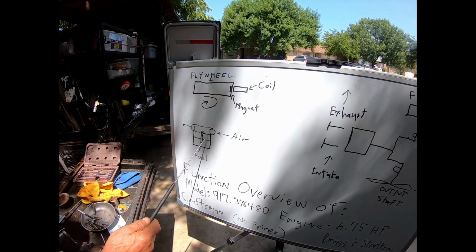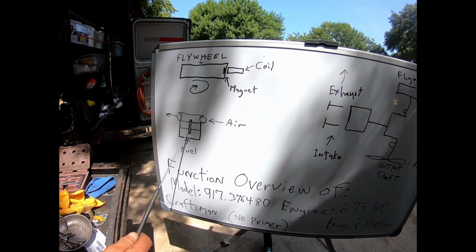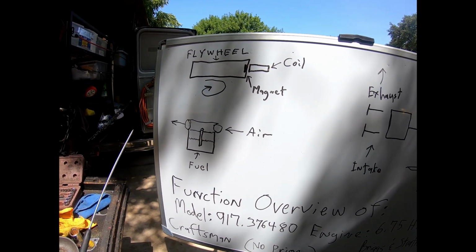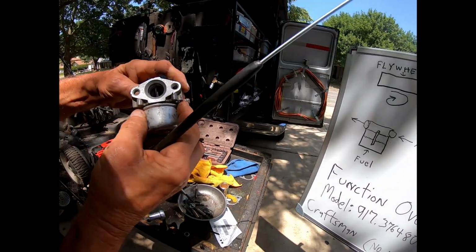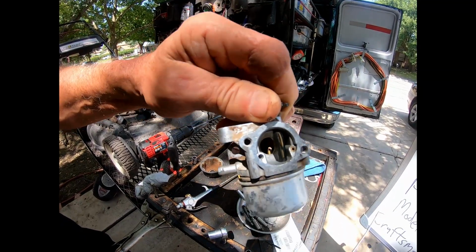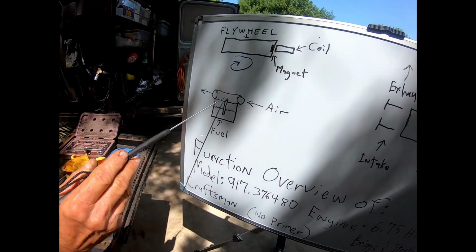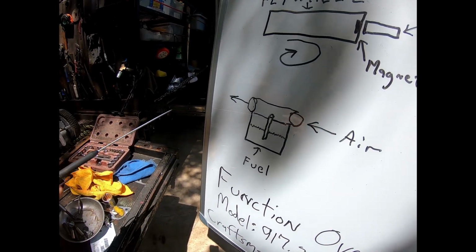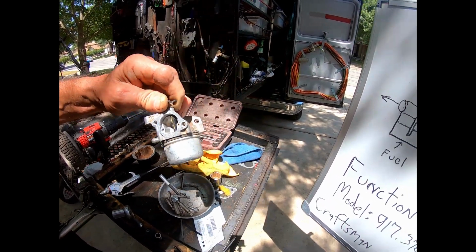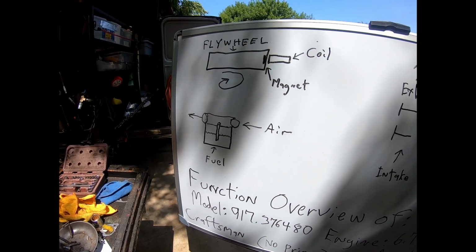So essentially your carburetor, there's a float right here that regulates the amount of fuel that's in your carburetor. The bottom of this tube is in the fuel. The top is right in, you can see it, the little brass piece right here. So the air flowing over this creates low pressure, which sucks the fuel up. And then there's a couple of little holes here that pressurize the tank a little bit. But that is essentially what happens. So, as I said, that's called the Bernoulli effect.